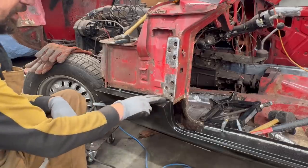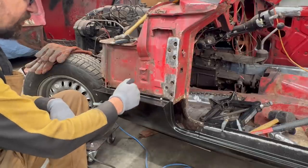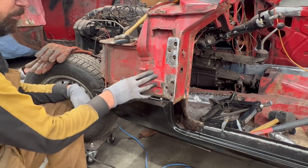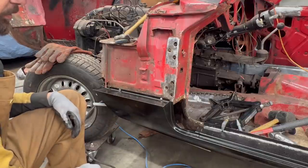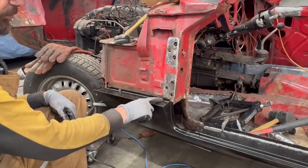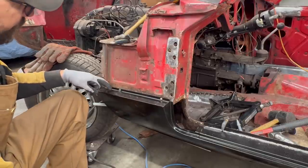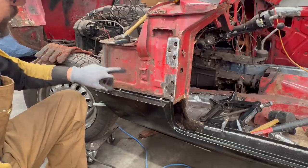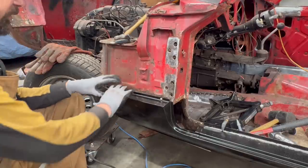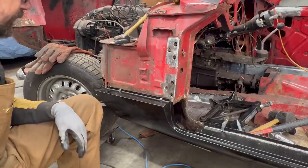I think I'm going to start with this repair here. I want to remove the seal and repair this flange here underneath and maybe we're going to keep going down and repair the bottom of this panel because it's all rotten — the inner A-post, whatever it is called. But here, as you know, I have the holes for my reference, for my height of the seal. I measured from this deck up six inches and I marked where it is here and here. Now I can take this out, repair this, put it back and measure again six inches and I can drill my new holes for the screws because I'm going to lose them.